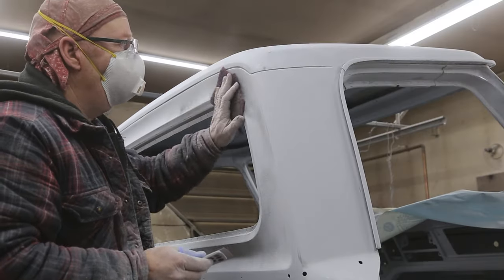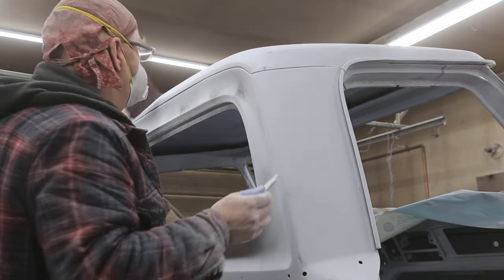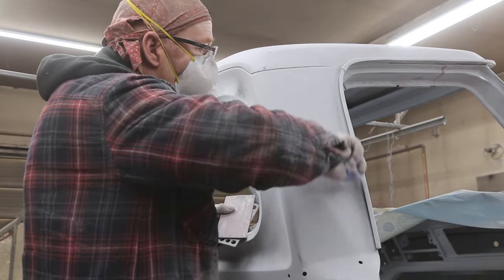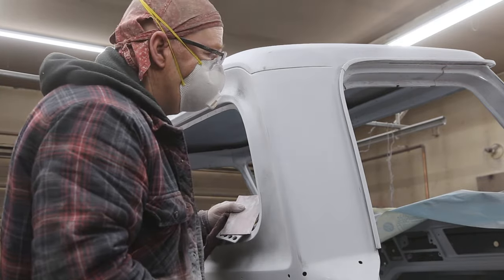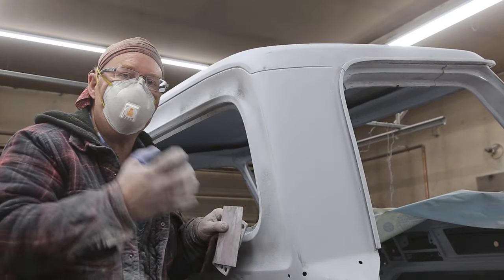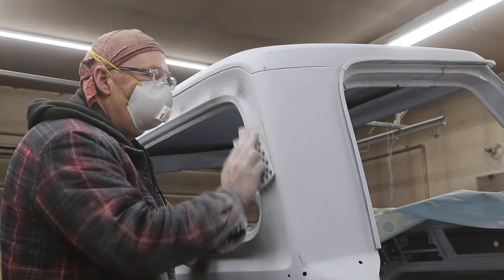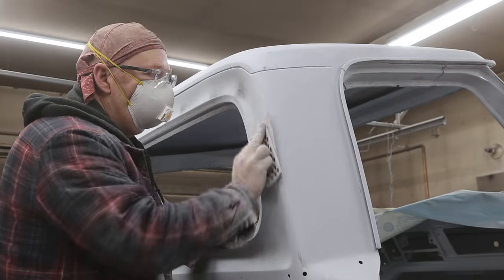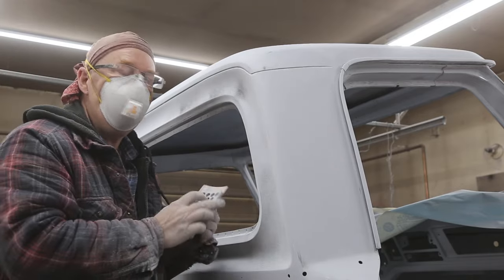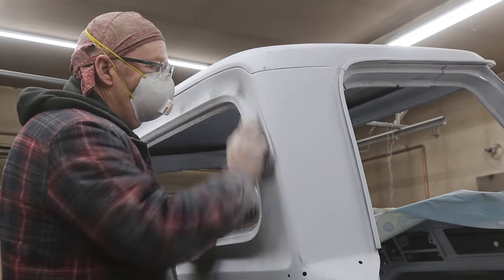Pillar is coming along pretty good. I want to make sure that I get all the roof done, and I want to start caulking today in here so that I can get a couple coats on there and let them set up for a few days. I don't want it to shrink after you paint it. That wouldn't be so good. And it takes quite a while, when you get her on there fairly thick, for it to completely set up.